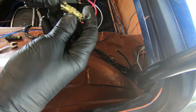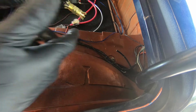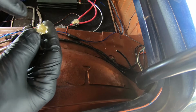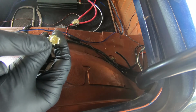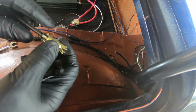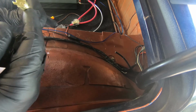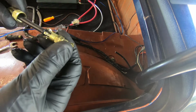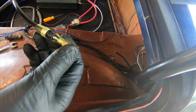Okay. So it says to put this on and push it on about four revolutions. Well, that's odd. There are no threads or anything. But why they're telling you to twist it is so that you get the very center portion of this coax into this little hole in here. I thought maybe the O-ring needed to be down inside of here, but I don't think so. I think it actually ends up making a seal for here so that moisture doesn't get inside from this way.